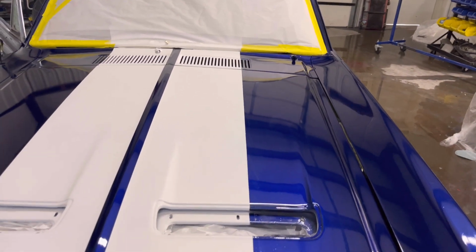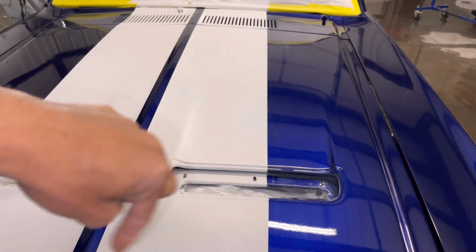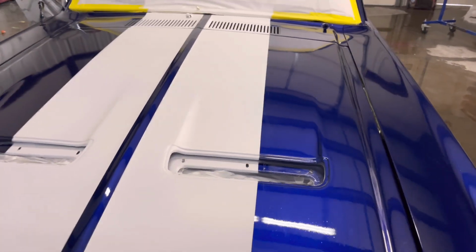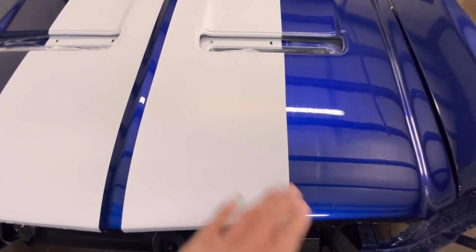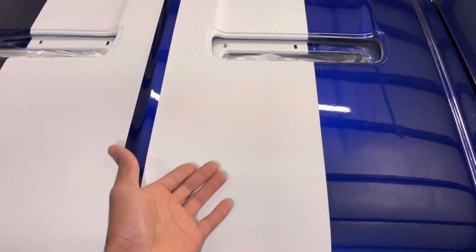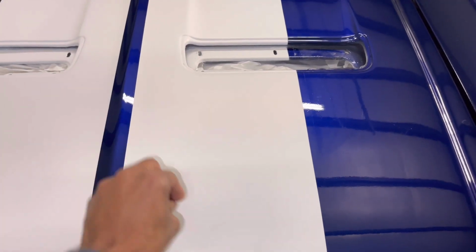Now, let's say we didn't have mid coat and we cleared it. We cleared the whole thing with the pearl inside the clear coat. So we put that blue pearl straight into the clear coat and hit it twice, and the pearl is busting. Clear coat looks good. And then say you got a run or some trash in there and you try and clean it up, get it out, and you punch through the clear coat and you hit the paint, hit the white.